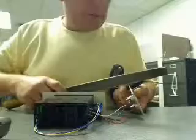This is the cable from the front switch. You'll want to plug this just below the green connection — the green connection is your power connection. Now we'll want to cut a small slot on the bottom of your back panel for the 485 cable to go through. It's a flat cable, so it makes it relatively easy. Take the bottom of your panel — you can do it at the top, it doesn't really matter, but we usually put it right in this area. Use a large file or a knife and cut a slot into this. I've cut a small slot in the back panel. You can use either a knife or a large file — it doesn't matter how you do it, just get it done.